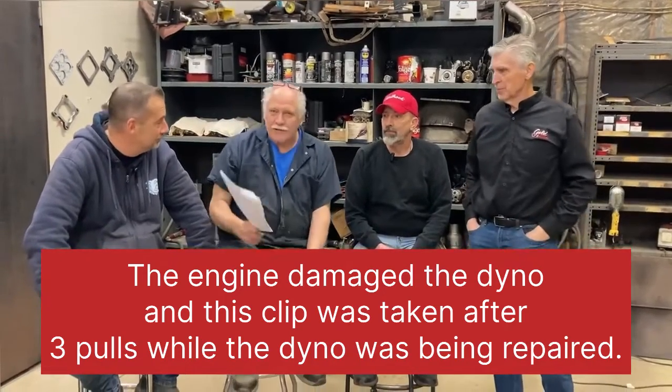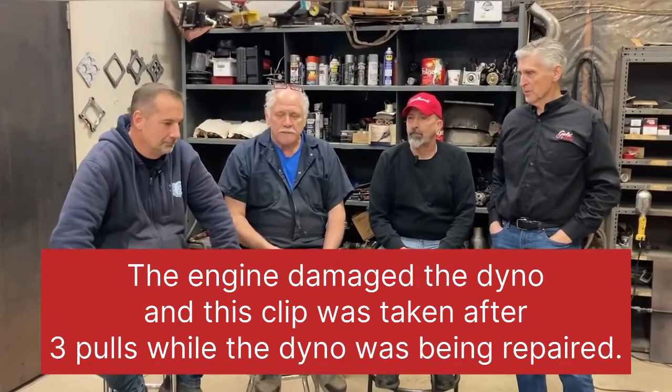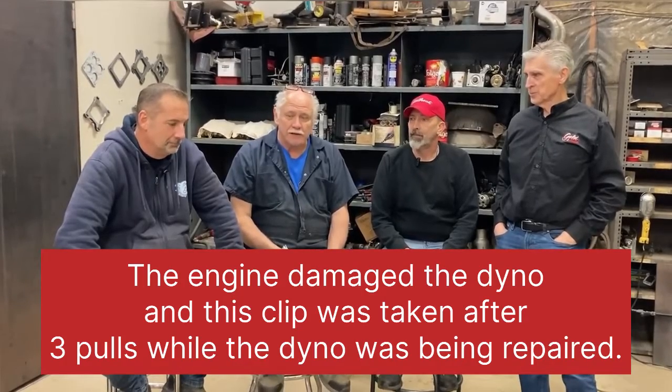Okay, so we started out, I guess, with the carburetor. Tim brought me the carburetor, and it had been on the engine apparently and running. It had 86 primary jets, 87 secondary jets with no power valve, and that's pretty lean as far as I was concerned. We found a lot of corrosion in the fuel bowls, so Tim and I spent Friday afternoon taking the carburetor apart. Tim washed everything up for me, and we put in new accelerator pumps and gaskets, and we started with 90 square jets because I thought that would be a better point to start at, right, Tim? Oh, absolutely. And so anyway, that was the carburetor.